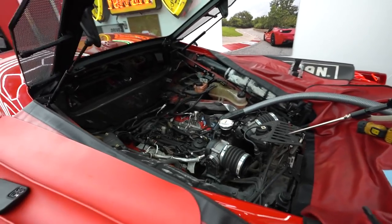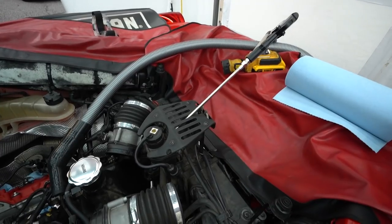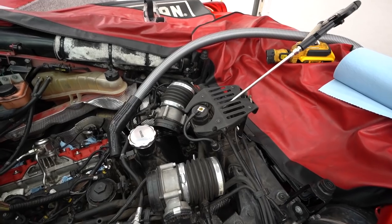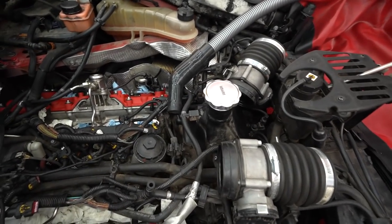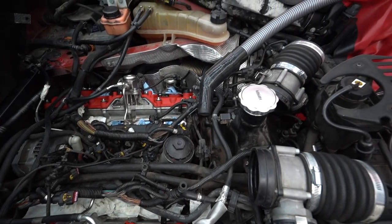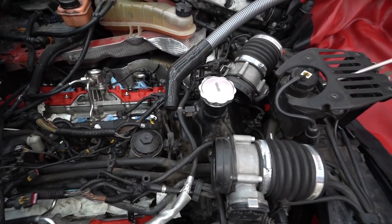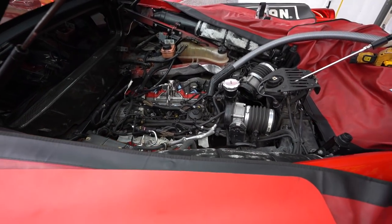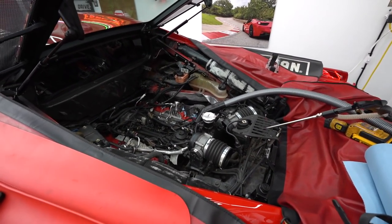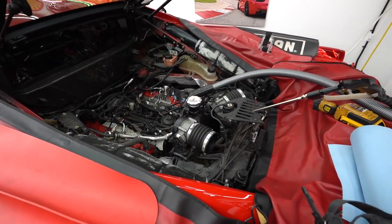A couple of tricks I'm learning: you definitely want to move the wand up and down and make sure you've got good pressure — it definitely cleans better that way. Afterwards I'm actually able to take the nozzle attachment off and shove it right up in there almost to the valve to suck out any remnants. The good news is it's crushed walnut — if a tiny bit makes its way into the cylinder, it's just going to burn up, which is the whole reason we're using walnut instead of sand.